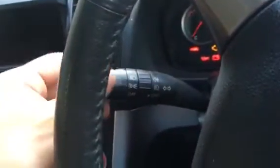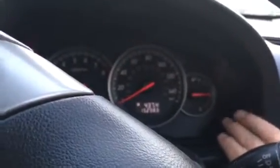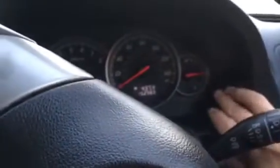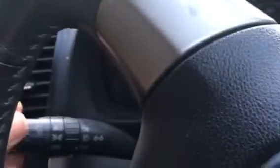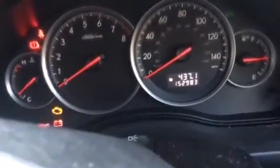What you do: turn the ignition on, then turn the lights to on — they should be off first, then on. Press the trip button four times, then turn your lights off, then four times again, then turn your lights on and go four times again. It will then show you your BCU body control module and your engine faults.